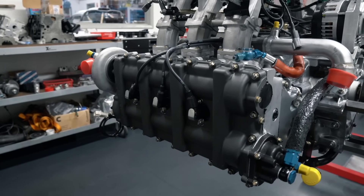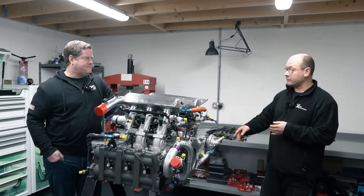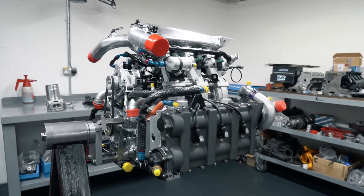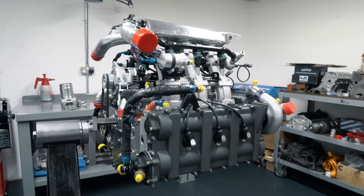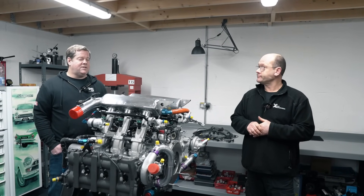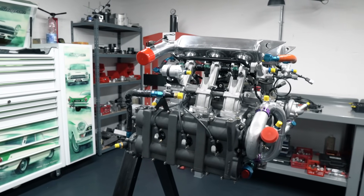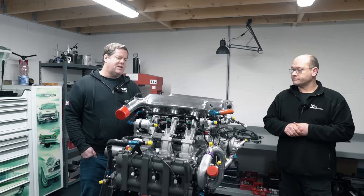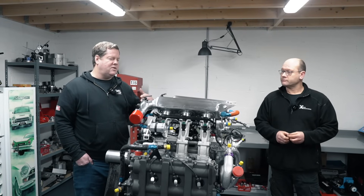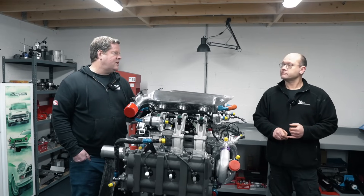Cost-wise, what would it be to build a dressed Group C engine? It's 250,000-300,000 pounds as they sit there, if you could buy that engine - which the owner would probably never sell, because you can't buy another one. No one can really put a price on them at the moment. This is a 3.2 litre with individual throttle bodies and it's turbocharged. We have a special mapping strategy on this - we actually use four-dimensional mapping, with up to five different fuel maps for the different throttle blade angles. Being turbocharged, it's quite important to do all the dyno work properly.